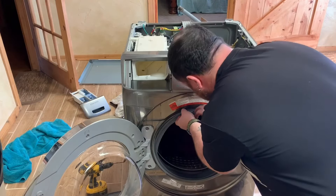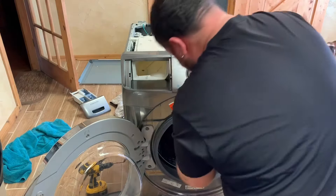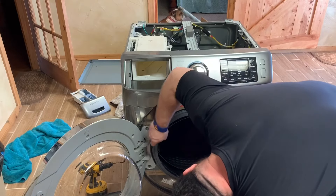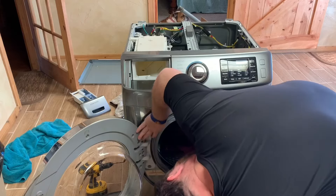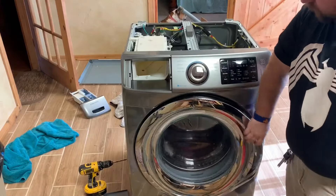On that seal, it actually has a rib that fits down around the door frame, as you saw when I took it apart. Once you get that little crevice seated around the door jamb, you put the spring back on there — and what that does is it seals the gasket.